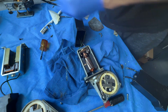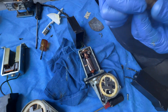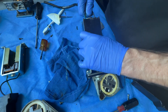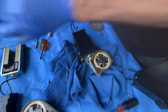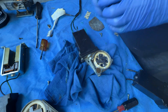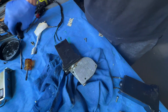Then secure it down the bottom again with the two flat heads. Put a little cap on that groove retainer at the top — there's a little black plastic cap which you can pop over that, stolen from one of the other ones. Then the casing can go back on. Just grease up everything you can, get rid of the old crud and put some new grease in there — it has really set into some very firm gelatinous mass. I'm now resealing the one with the 123 cog — there are just three flat head screws to go on.